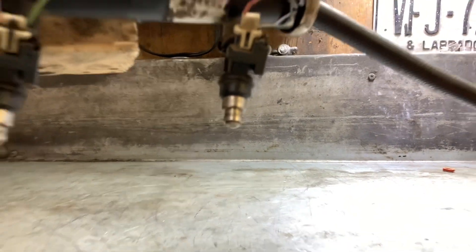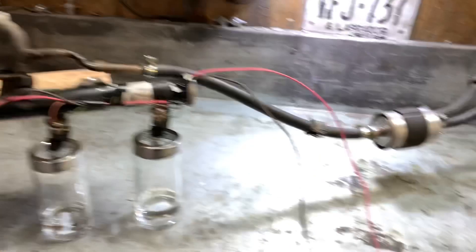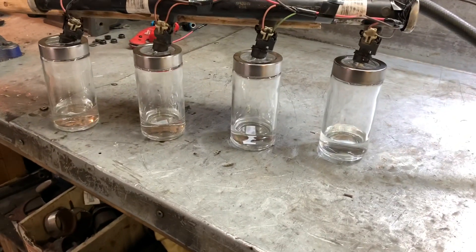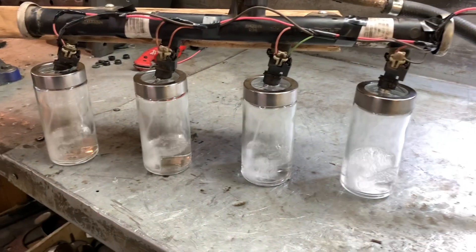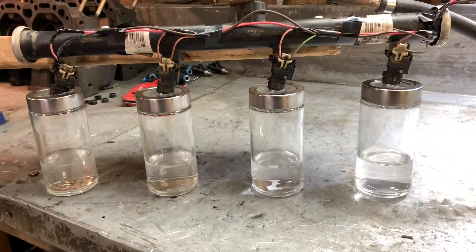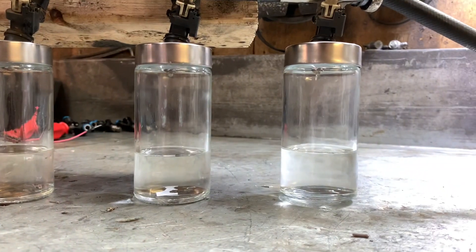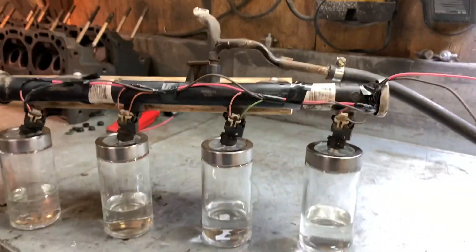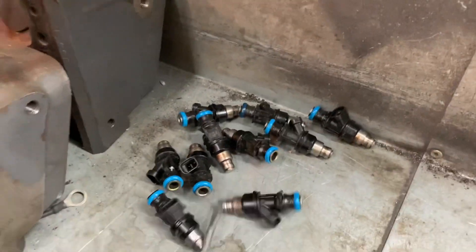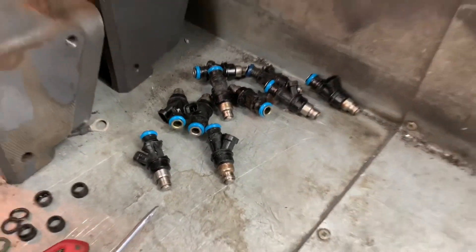One thing I always like to do when you're done testing a set of injectors is to release the pressure off the rail — there's 58 PSI rail pressure. If any didn't bleed back, we're at max pressure. So it's nice to relieve the pressure on your injectors by energizing them. I forgot to do it once — I released the clip on an injector and made quite a mess. Pressure's all off. Now we can take out the injectors, throw away these three, keep that one. And I think I'm just going to go on and retest these again because those are ones I already tested clean, making sure they weren't leaking. I'll test those, see what the flow rate is, and I'd say I'll always be using those in the Cadillac.